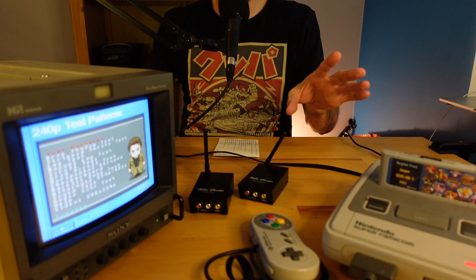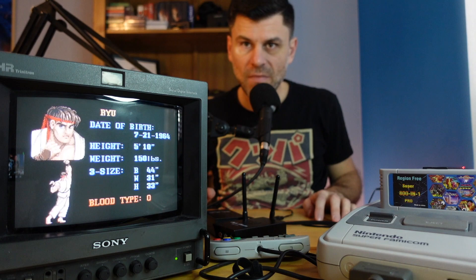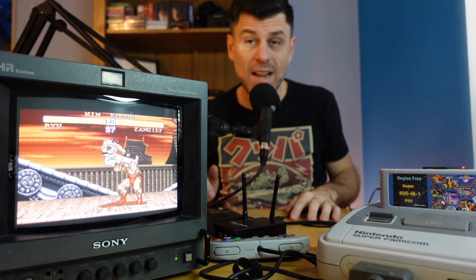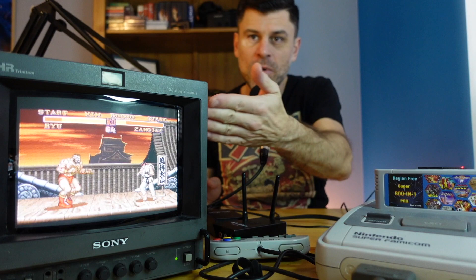The way I'm going to test is I've got my nine inch BVM here. Rather than always using the MiSTer, I have a one-chip Super Famicom. This says nine to twelve volts but the manual says nine. I've worked out that it needs exactly nine volts, less than an amp, but doesn't take five, doesn't take twelve. Now this is connected directly up — this is a hundred percent pure original Nintendo composite cable. Let's try and connect it up for the first time.